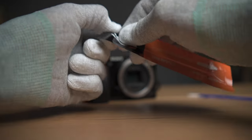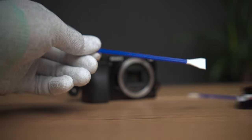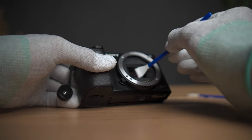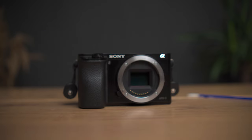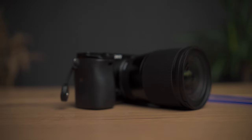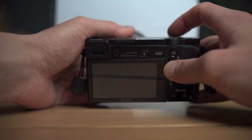After you're done with the wet swab, throw it away — you won't use it anymore. Then take the dry swab and do the exact same thing, cleaning all that extra wetness off the sensor, gently going from one side to the other. Do it twice if needed, and you can turn the swab the other way around as well. Make sure nothing is left on the sensor. After that, put the cap or lens back on, or best of all, take another test shot and compare to see if you got rid of all the sensor spots. Repeat the process if needed.